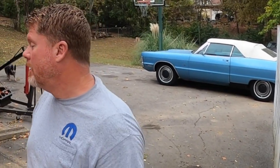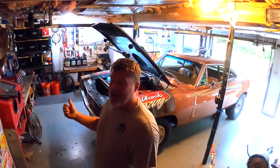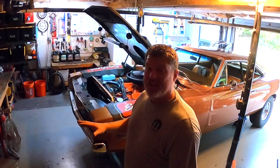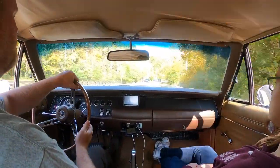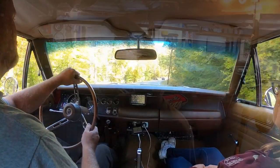Hey guys, Kevin Shaw here, editor-in-chief of Mopar Connection Magazine. This episode we're doing a little bit of work on our 69 Dodge Charger. Ever since we tried to do the Hot Rod Power Tour, we had an overheating issue. It was really hot that week and a lot of cars were boiling over. We always ran Peak antifreeze, the 50/50 pre-diluted mix, and the car liked to operate around 190-195. But ever since Power Tour it's been running up in the 200s, even just driving around town. One factor could be our mixture being way off, as it's been diluted with some water.